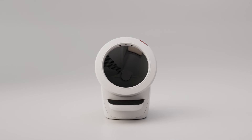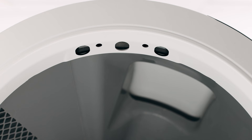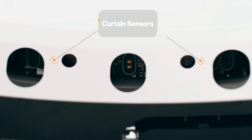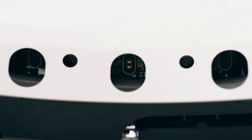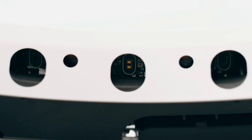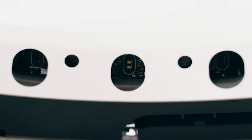These sensors detect when a cat has entered or exited the unit. The three laser sensors are called curtain sensors and are located in the bezel. Debris such as dust or cat fur can interfere with the operation of these sensors. This can cause the unit to inaccurately measure the waste drawer level and litter level, as well as falsely detecting a cat.